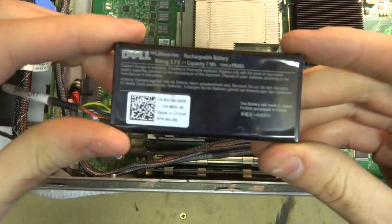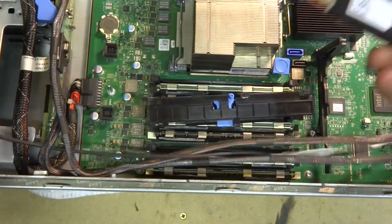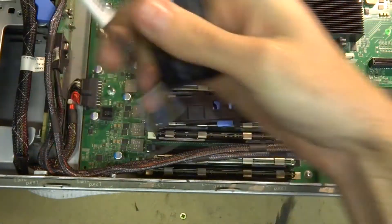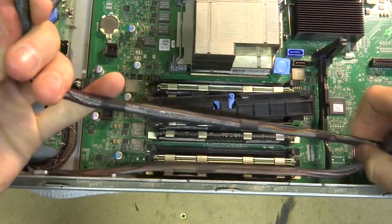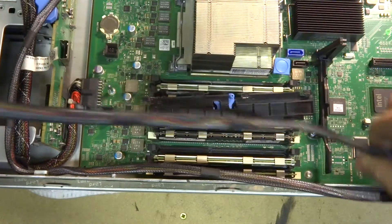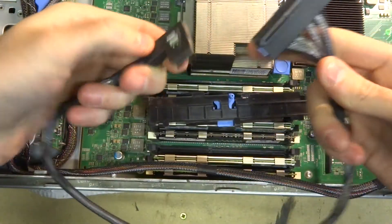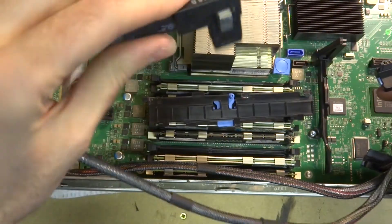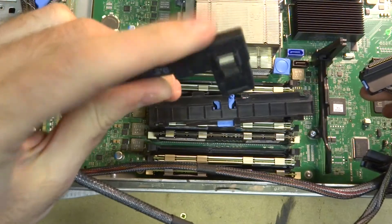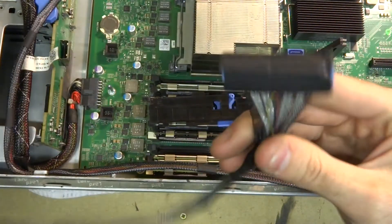So that's the backup battery for the RAID. Won't be needing that any more, so that can come out and stay with the card. And these SAS cables just unplug quite nicely, so we won't be needing these again either, because the H200 uses this mini SAS connector on both ends, rather than this narrow and wide one.